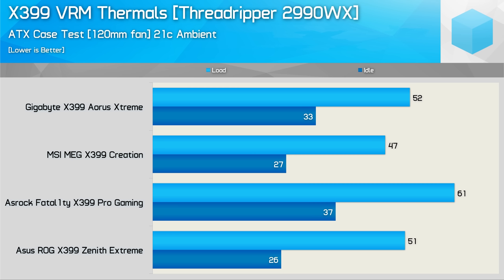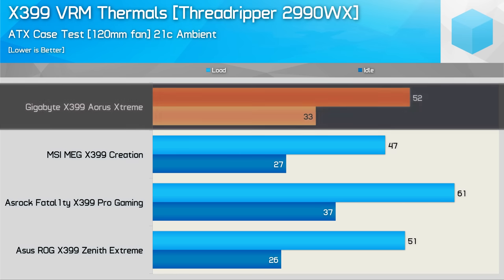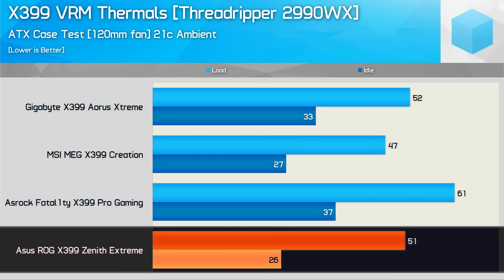With the boards installed inside the Corsair 500D with direct airflow over the VRM heatsinks, temperatures dropped noticeably. The ASRock board dropped 10 degrees for the load result, which isn't too bad. The Gigabyte board dropped by an incredible 26 degrees, telling us two things: those 35mm fans clearly aren't working very well — otherwise we wouldn't see such a dramatic drop from adding case cooling — and the finned heatsinks work extremely well when fed cool air via case fans. The MSI board dropped 14 degrees with airflow, while the ASUS board dropped 11 degrees. So with the exception of Gigabyte, we saw a 10-to-15 degree reduction when adding case cooling.